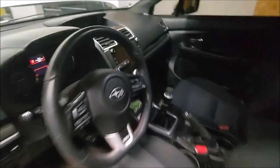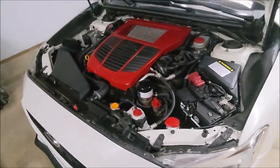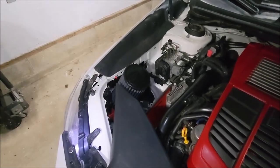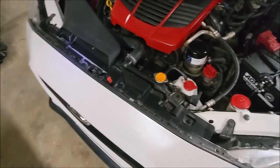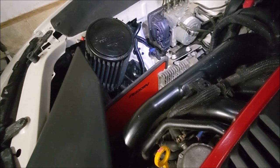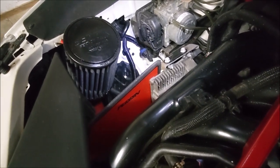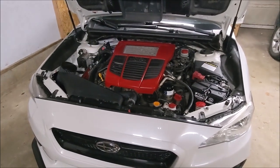You can see the white badge back there. Of course, six-speed manual. Got the Android head unit. But now about this video — and the engine bay, I just painted some bits. So this is about the Perrin intake. As you can see, I got it installed. Looks great. I do love the red in these engine bays. I don't have the Perrin shroud, so I just painted that red. I do have the radiator shroud coming. Install was very easy, straightforward. The only thing I'll say is online everybody snips off the extra gasket right there because it hangs over about two inches, but if you just cut a 90-degree in it, it folds down and gives you that little extra seal between the ECU bracket. Cut it and fold it down — I think that's what it was intended to do. Now that you've seen it, let's go ahead and go to the clips of driving with numbers before and after.